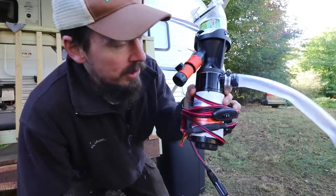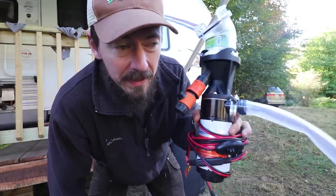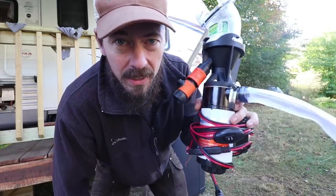I'm timing myself this morning to see how quickly I can get this done, and we're also testing to see when the black tank is actually full of waste, can we pump it to the house with this macerator pump, which basically grinds waste and pumps it through a garden hose. We're pumping the waste from our trailer into the septic of our house.